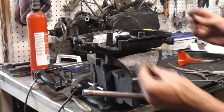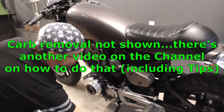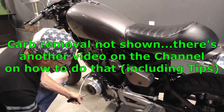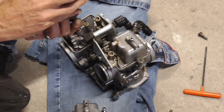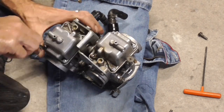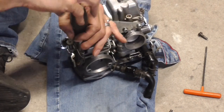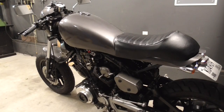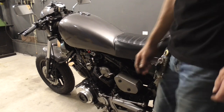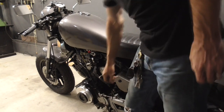So we've got our two jets. Now all we need to do is put them in the carburetor. Time to pull the carbs up and redo this little problem. So we've got our jets changed out — let's stick the carburetor back on there. We've got our bigger jets in and we'll see if it'll throttle up now. Maybe it'll have a little more oomph on the top end. It might still have a little trouble transitioning because I may have to raise the needle up, shim it up a little bit to get some fuel. But hopefully it'll fire up and throttle better.